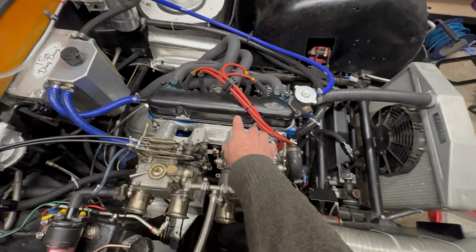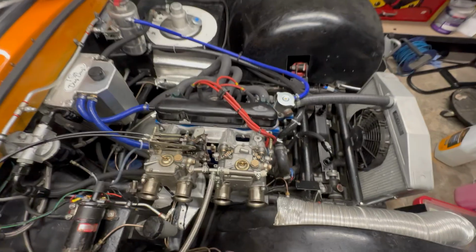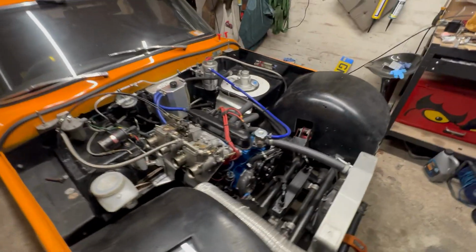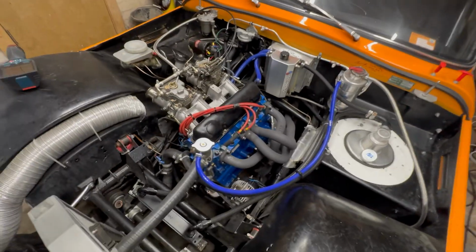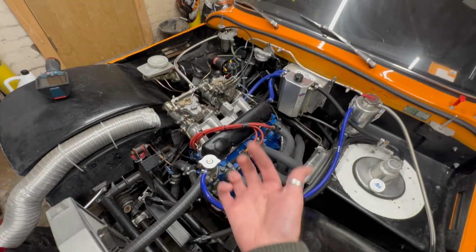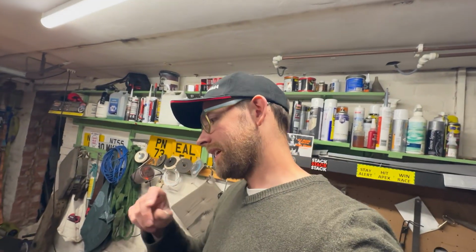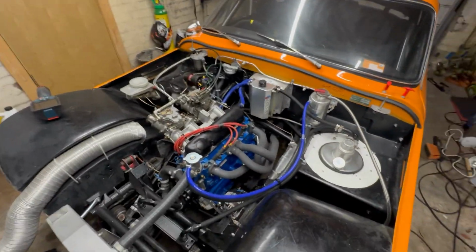So number 2 and 3 cylinders showed a bit of signs of heat, but number 2 had taken a lot of temperature. So it was definitely an airlock situation. Fueling seemed okay. Essentially it's had to have a new piston ring in number 2, an exhaust valve, and the seat just needed reseating, which is why I was a little bit low on compression. So that is in, it's refitted, and now I've got a header tank.